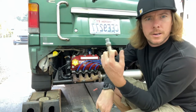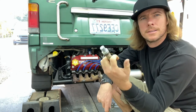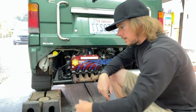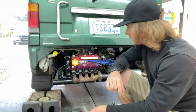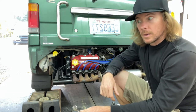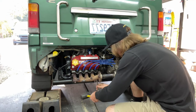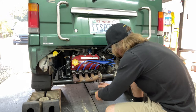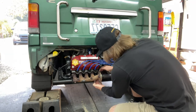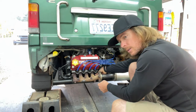So obviously what you're going to need is your O2 sensor — I'll have a link in the description below if you're looking for one. Not very expensive. Changing it doesn't hurt anything; it might potentially make it run a little better. And you're going to need a seven-eighths wrench. You probably want to wait for it to cool down if you just moved it, because it's going to be hot.